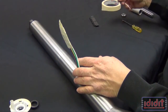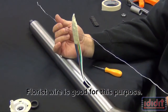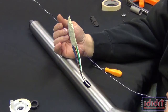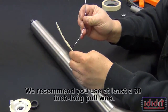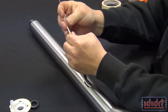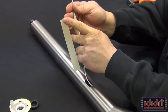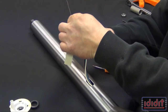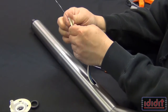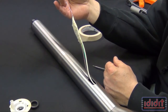The next thing we'll do is use a pull wire — any kind of wire that's flexible but yet sturdy at the same time — so that you can pull these wires back out the column when you install the new harness. Put the wire in between and put a little hook on it, get it flat, and then put another piece of tape on it to keep it on the wire ends. That should secure that pull wire to your wire ends to install the new harness when this one comes out.